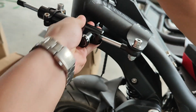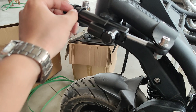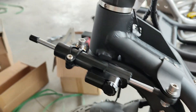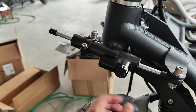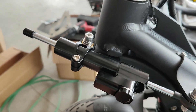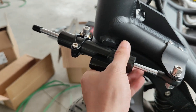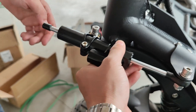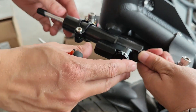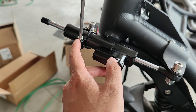Then you fix the steering damper's two sections into the scooter. The last thing is to use the M5 Allen key. You can see the steering damper moving around without this part being seized. Make the wire face in front, then try to find the position where the distance on this side and the distance to this side are equally similar, so the steering damper will be able to move evenly, then lock the nuts up.